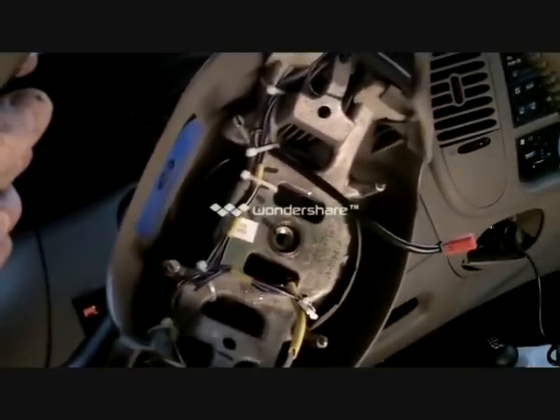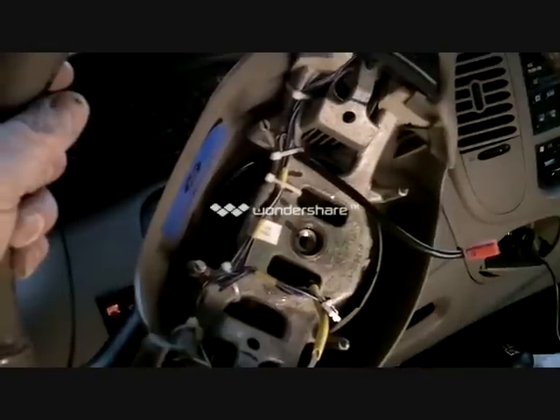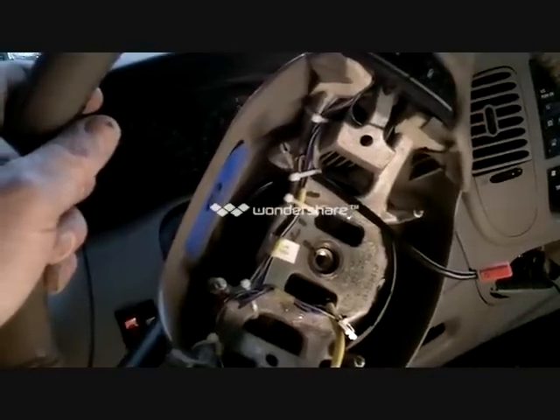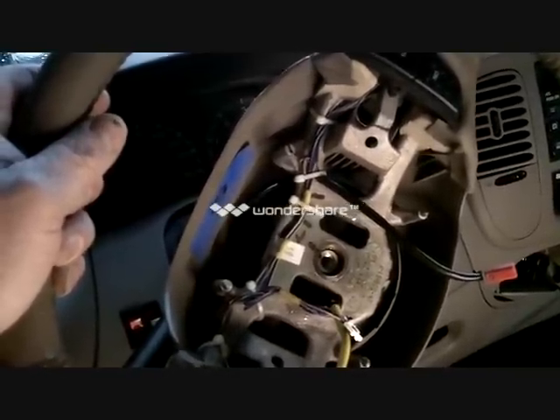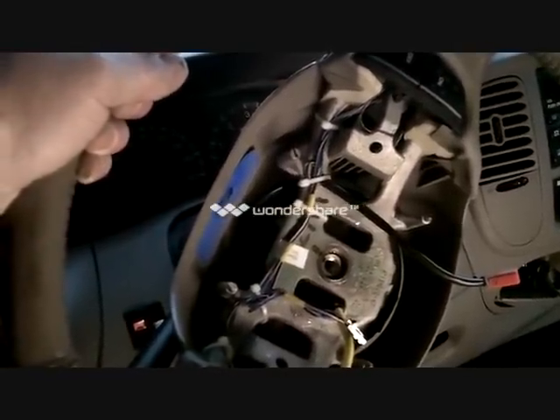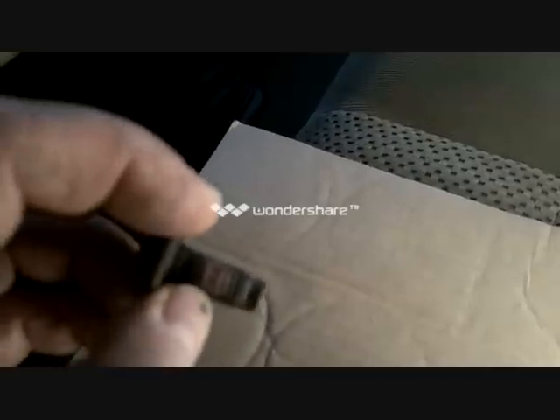Put the caps on and we're pretty much done — it's just a matter of testing it out, hooking up the electrical connections and the battery, and the solenoid wire that I've taken off. Seeing that I've got the electrical connections off the battery, I might as well check the electrolytes in the battery while I'm at it and put in some distilled water if it needs it. This is the steering wheel bolt — you can see they had some sort of Loctite on it originally. So I'm going to put a little bit of blue Loctite on, just a dab — it's a removable strength just to keep it from backing out. Better safe than sorry.